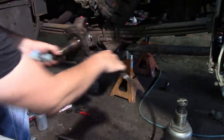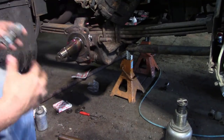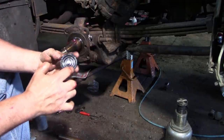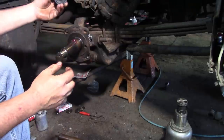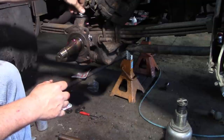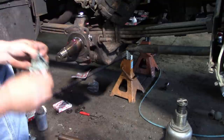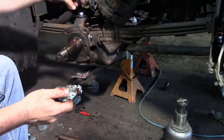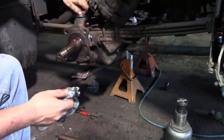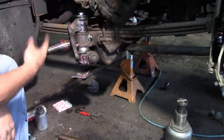Okay, I see grease coming out. Isuzu has done an updated top seal — it's actually a seal with a washer and a nut. Before it was very small and didn't seal very well. This should probably help fix the problem because the seal I had before was less than fantastic. So I'm going to get this tightened up and we'll go back together.